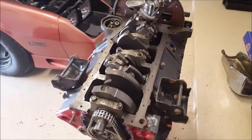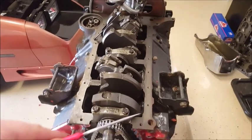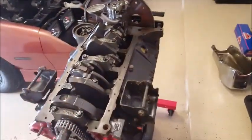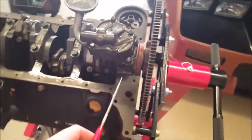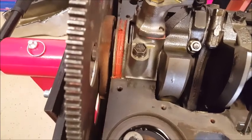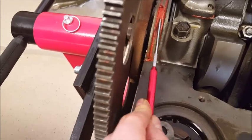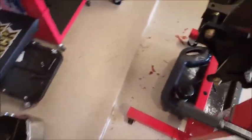I've gotten a majority of it done — removed most of the gasket from here, which came off pretty easy with the scraper because of the oil. There were a couple spots that were a pain, but I just put a small amount of brake cleaner on there and it came right off. The part I wanted to show you was here on the seal on the back — since you can't really get a scraper in there, I was using this tool and it actually works really well. It comes right off, so it's a pretty easy process.